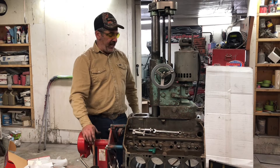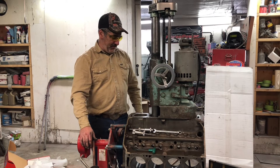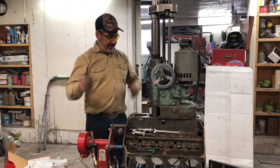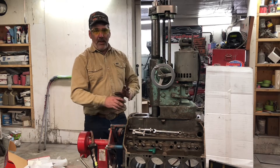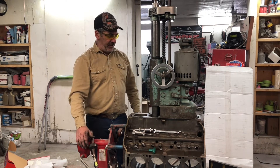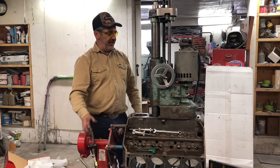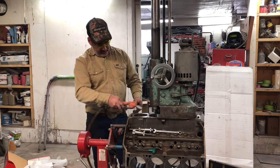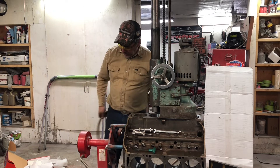Anyway, this can be a dull job in some ways. Take your time with these boring bars — they're fairly simple. If you're used to running a lathe and cutting everything on the outside, you just kind of got to get your brain around it a little bit. When we first got it, we were both machinists but hadn't really done this. I just took a scrap block and bored at it and tried to figure out the little differences. We ended up cutting holes a little too big and doing a few things. It's just way easier to do this on something you don't mind losing the first time — then you've got the basics of how it works. That's why I thought maybe this video would be handy for somebody.